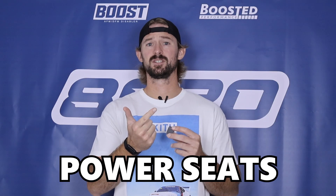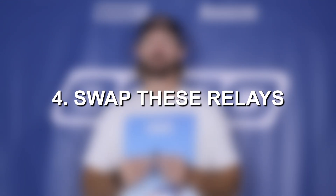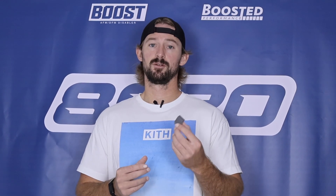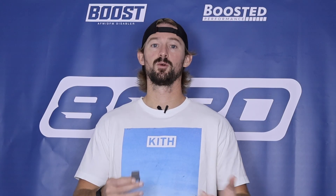These relays are used for things like your car's horn, power seats, heated seats, windshield wipers, and other components that aren't crucial to the engine running. So take the horn relay, for example, and swap it with the starter relay. If your car starts now and it wasn't starting before, that's a good indication that the relay may have been bad. Then go ahead and push the horn to see if it actually works.